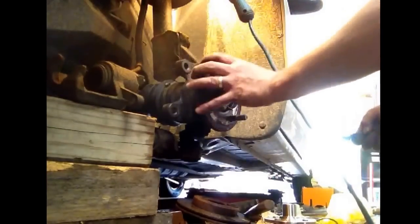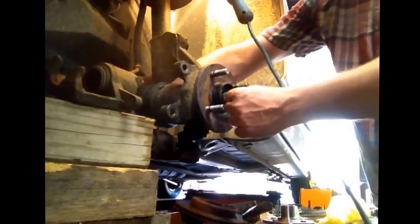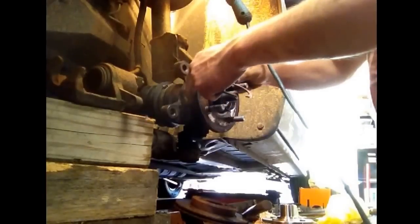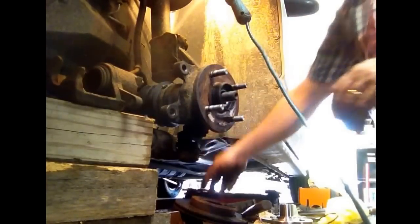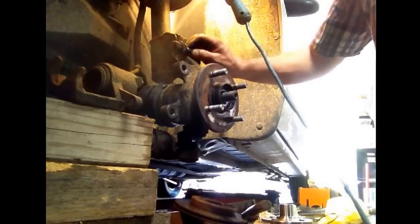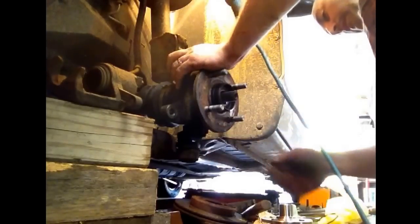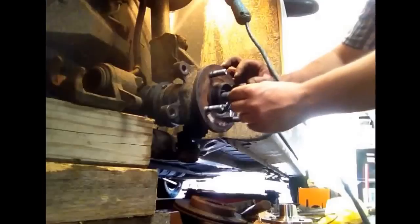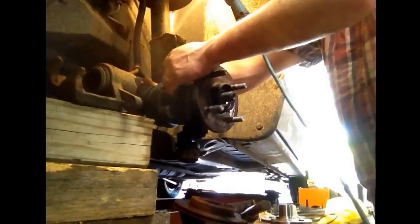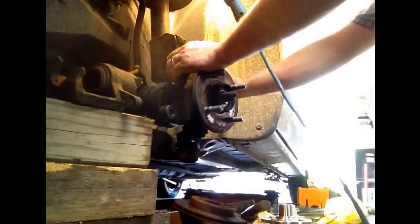In order to get this out there's a clip ring. There's one on the back side. I got the shaft loose and out of the splines, but this won't come off until you pull the clip ring from the back side. It's kind of a pain — you can't really get in there. So what I'm doing now is pulling these bolts that hold it to your strut. The whole idea is I'll be able to swing this forward enough — I also have the bottom one loosened up in case I have to pull off the ball joint — to get this to pull forward enough so the shaft will go completely out the back, then I can access that clip ring, and once I can access that, the assembly should come out.